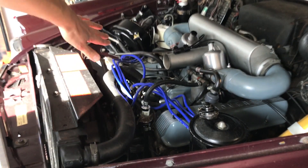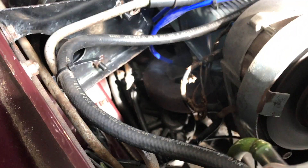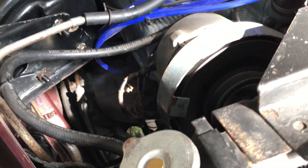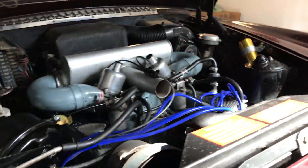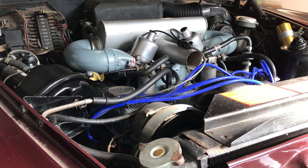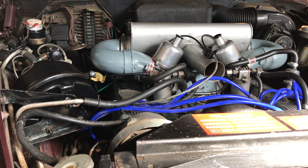No fuel coming out. You can see it burning a bit of oil — smoking a bit out of there. I think that's just burning off brake fluid that I spilled on the manifold during the brake rebuild. The choke's on — give it a few minutes to warm up. We can't leave it running too long really because these flats are very close and they don't like me running the car in the garage.